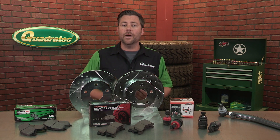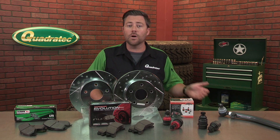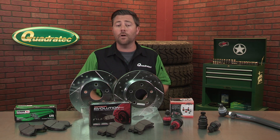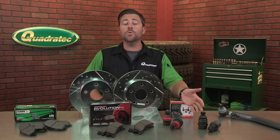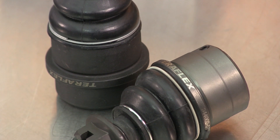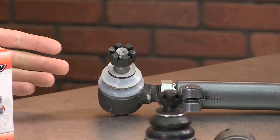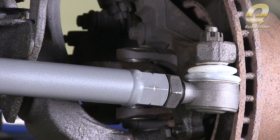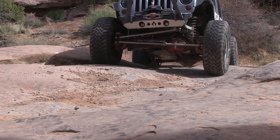Now of course, you don't want to forget about your steering components. Things like ball joints and tie rod ends are especially susceptible to rapid wear in modified Jeeps with oversized tires and offset wheels. So swapping your factory ball joints to heavy-duty ones with all-metal internals can drastically increase their lifespan and help you keep your Jeep under control. And the heavy-duty steering kits with oversized components, originally designed for heavy-duty trucks, can also help keep your Jeep in line, whether you're heading down the highway or muscling through some tough rocks or mud off-road.